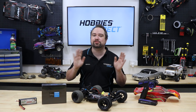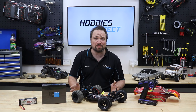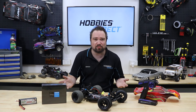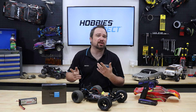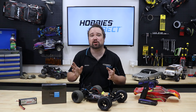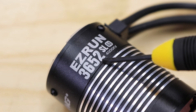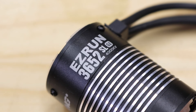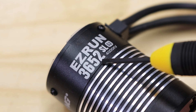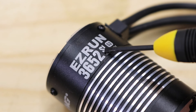I can remember all too well the first time I tried to find a suitable brushless combo. I remember thinking, what do all these numbers and specs mean, and are they even important? So I thought I'd try to help out by running through these common specs to help you select the right combo for your particular RC car. The motor spec is 3652SL — this is the motor can dimensions, meaning the motor is 36 millimeters in diameter and 52 millimeters long. The SL stands for sensorless.